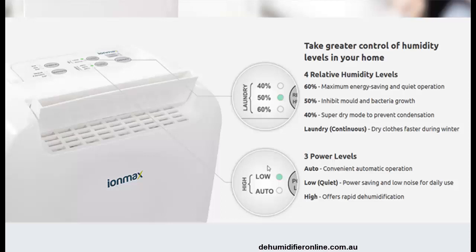And then if you want to dry clothes inside, put the clothes on a clothes horse or something like that, and put the unit in front of it and run it in laundry mode, then it will generate more heat and dry quicker. The different power levels really effectively controls the fan, and so obviously the higher the fan runs at, it will dehumidify quicker, but also the noise of the fan will be increased. You can also run it on low or quiet, and it is really quiet. I have used it and been able to sleep while it's on.